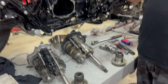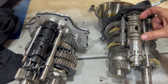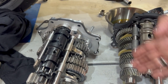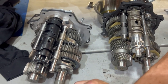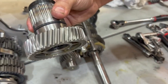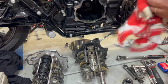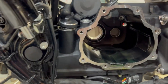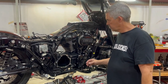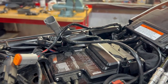I'll bring the camera in here and let's take a look down at the gear set. This is the stock transmission, and you start to see that this particular piece is cast versus this which is machined billet tool steel. These are all straight cut gears versus a helical cut style gear. You can see the thickness of sixth gear versus those — we're talking about a whole lot more beef right there. This transmission actually drops the RPM in sixth gear by about 250 to 300 RPM. Other than that, it's meant for racing — super tough. Through the ThunderMax we'll be able to recalibrate the speedometer, the gear indicator, everything will be dead nuts correct and accurate.